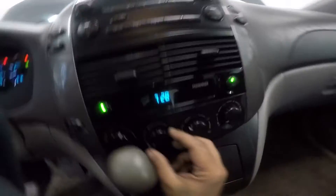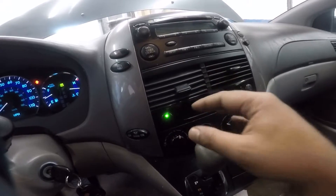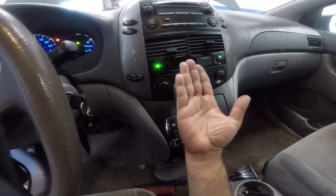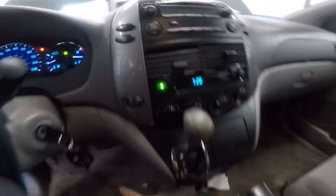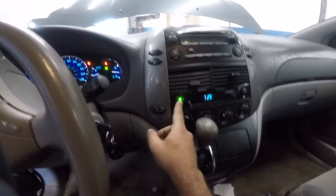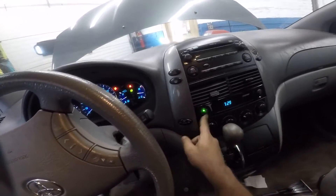It's not cold. Make sure it's on blue. If you put it on hot - yeah, it gets hot. Goes back to normal temperature. Pretty much what I did here was checked my blend door motor - does it open to heat, does it open to AC and close the heat? The blend door motor is working. On the AC switch, I feel nothing - no click, no load, engine RPMs don't change. The AC is dead.